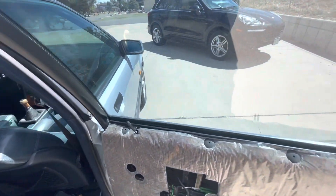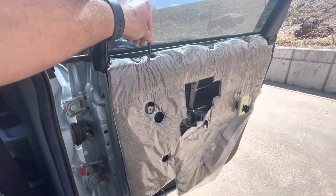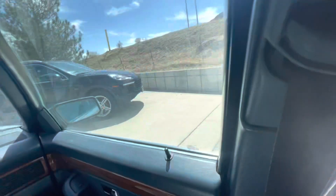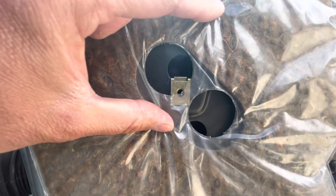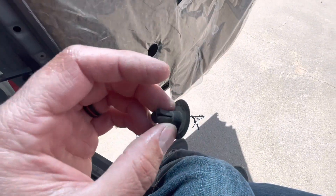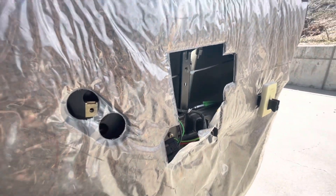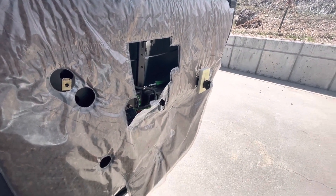The second issue was the door locks would not work. There's a pivot thing that goes up and down, and right in the center of this hole there's a pivot bolt — and there was nothing in there. I found a door clip that I just popped in and pushed, and it held the pivot in position, so we're good to go on that one.